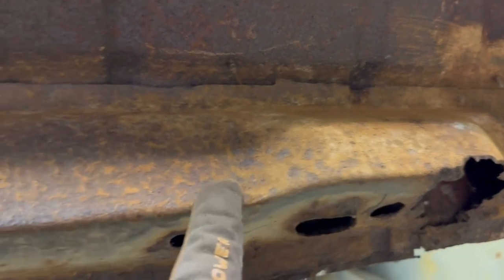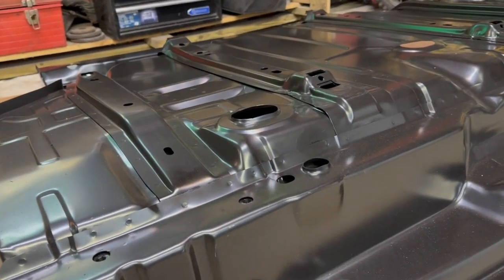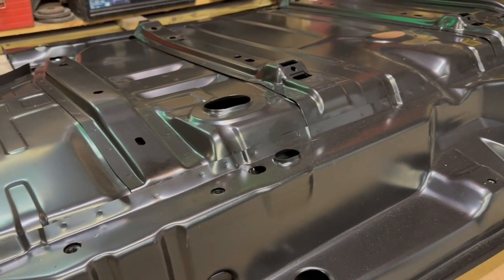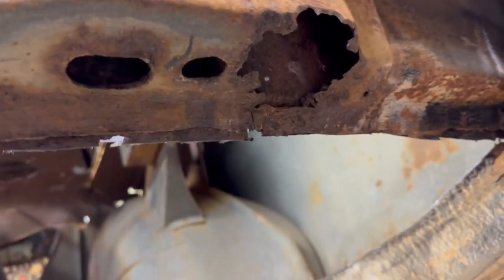Here's where I have to get pretty crafty — see what I can salvage. Maybe I have to cut this whole thing right along here to remove this, utilizing that flat part where the body mount resides from the donor piece. Maybe I'll do the same type of thing when we put the firewall piece in — cut it halfway through to make sure I have the dimension correct.